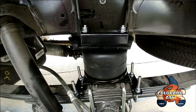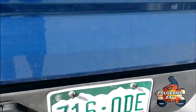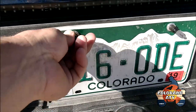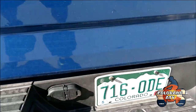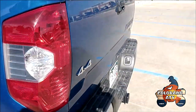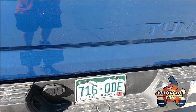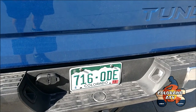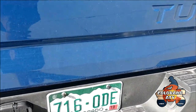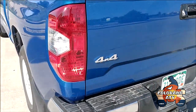Not so bad. All in all, the whole project may take about an hour. Got both airbags installed. I ended up putting both air inlets on each side of the license plate to fill up air for left and right, and so far it's working great. Before loading the trailer, I measure the distance between the wheel well and the tire so I know the stock ride height. Then I charge up both left and right, making sure they're at the same PSI. I prefer putting too much air in to start, putting the trailer on, and then letting air out rather than adding air after the trailer's on — it's easier. Just let air out on each side, keep checking PSI, and make sure they're even. So far it's working great. Any comments or questions, leave them below and I'll answer when I can. Thanks, guys. Bye.